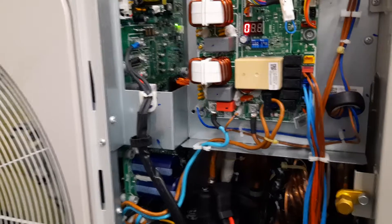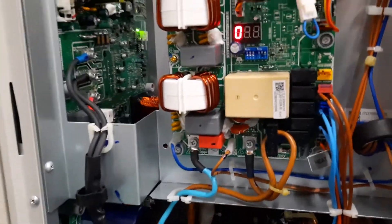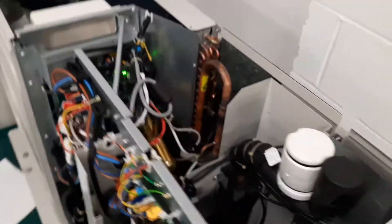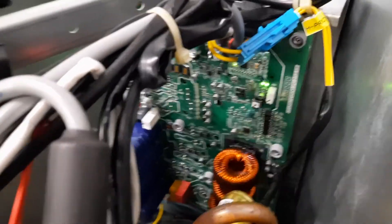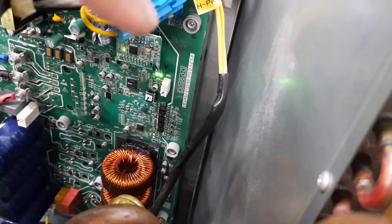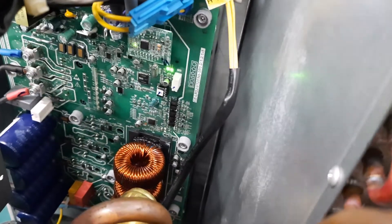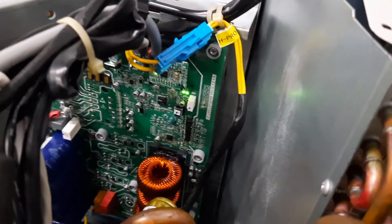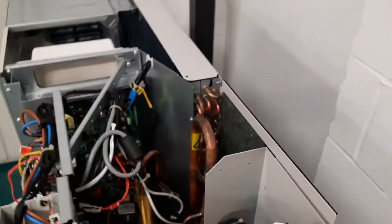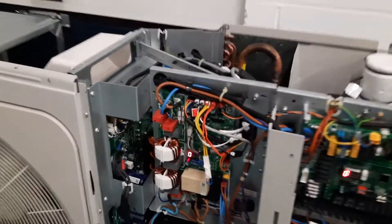Please don't touch anything because it will give you a hell of a kick. What you really need to do with an inverter is do a test on it — these can be really tricky, but I'm going to show you a few shortcuts. I've whipped off the lid of the unit, and from the top you can see the board is huge, pretty much the full width of the unit. I'm really only interested in one little part of it. If you look closely, there are three LEDs: one here which flashes very quickly all the time, and two green ones — one flashing quite slowly and the other constantly lit. Make sure those three LEDs are doing exactly that. If anything else is wrong, that PCB is fried and you need a new one. It's quite a tricky board to replace — you've got to undo quite a few screws to get to it.